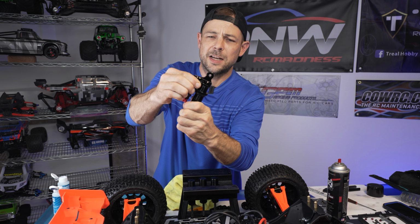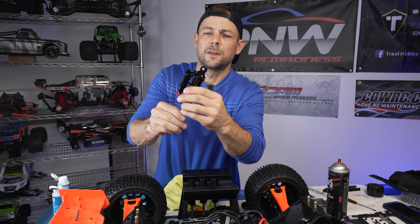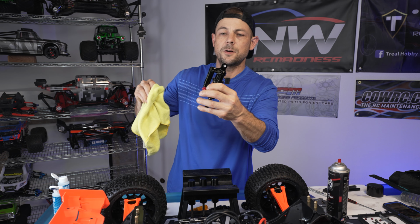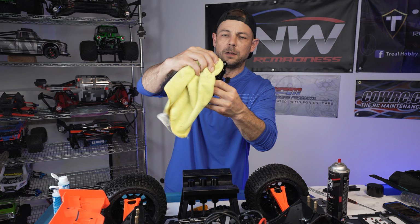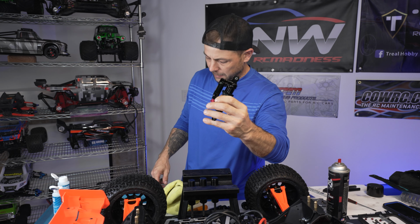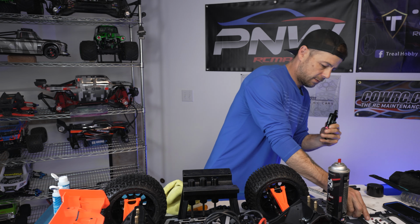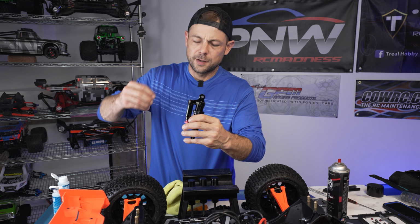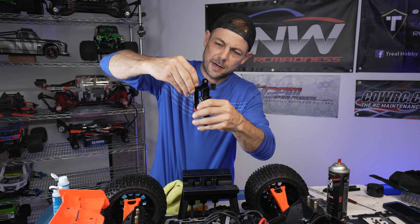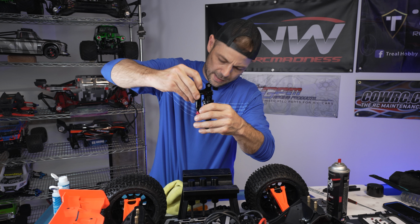And as you're tightening up the shock cap on the body, there's going to be some air escaping out. Go ahead, just push her all the way up, nice and slow, just like that. Wipe the oil, and then I just like to hold it for a second, and then you're just going to put the cap back on. All right, so there we go. Now, while you put the bleeder screw back on the reservoir, you're going to be holding pressure up on the shock shaft.